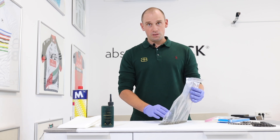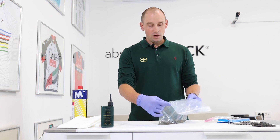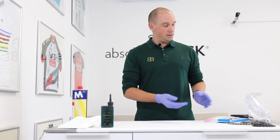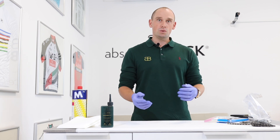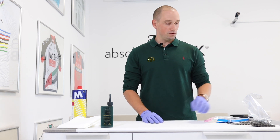I would suggest leaving it for at least 5 to 10 minutes so more of the grease will leave the chain. For optimal performance I would even advise leaving it overnight. In case you're using a previously used chain, you can repeat the whole process — remove the old solvent and replace it with fresh white spirit. This will ensure that all the excess dirt and oil from before is removed.